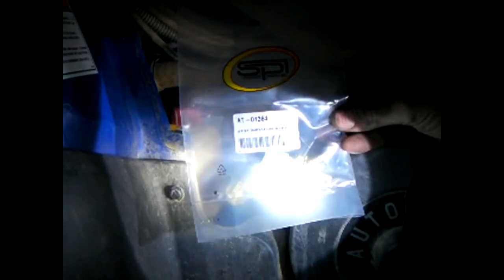I'm going to pop this off and put on a new temperature sensor that I just bought online. Pretty easy install — I just have to pop the wire off, unscrew it, screw the new one in, pop the wire back in, and done. If that doesn't fix my issues, I'll probably make the effort of swapping out the thermostat, which is here just above, as well as the water pump on the other side.